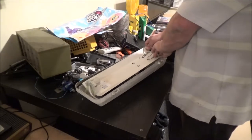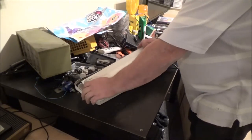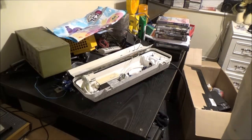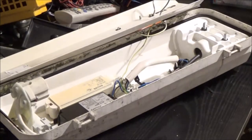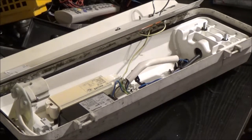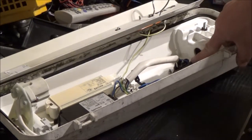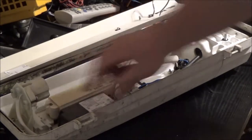I don't want to lose those washers. This panel just lifts up and out of there. So there's the innards — just zooming in so you can see what we've got in here. This is plastic, by the way, and I will give it a good old clean up. We have the photo cell socket over here, the ballast, the igniter, and a big capacitor there.